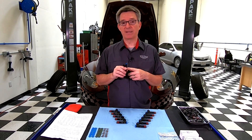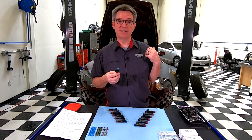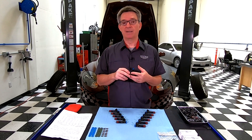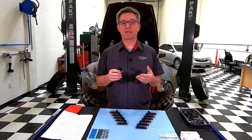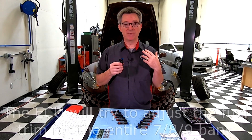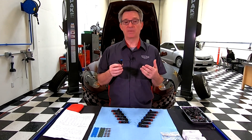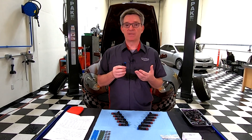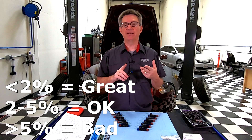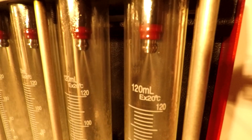There was only one injector that slow, and it was injector number 7. Remember, I told you I was chasing a lean condition on the bank of cylinders that included 7, 8, and 9 — this very well could have been the issue causing the lean at the O2 sensor. His opinion was that this 8% variance could actually cause a lean condition and could even potentially cause a misfire. The ECU won't know it's shooting 8% less fuel than it thinks into the cylinder — that's a lot in an engine combustion cycle. Jim's standards: 2% is excellent, 5% is sort of okay, and 8% is a fail. He also checked all the spray patterns — they all looked good.